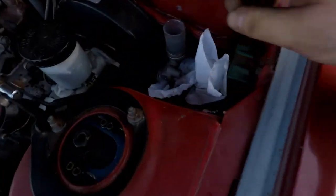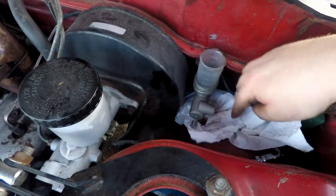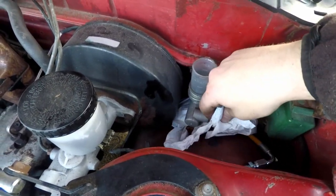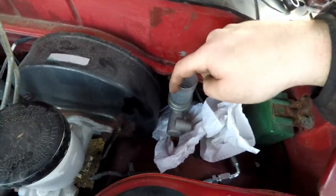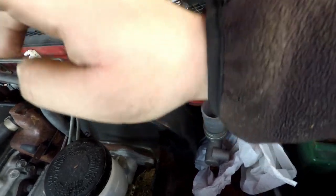I got the clutch line removed from the Master Clutch. Now the new line is going to be run down from the new one once I take this out, over the trans tunnel, and then down where this old line goes. I'm also going to delete the dampener - we don't need that, and I heard a lot of air gets stuck in the line. I'm hoping that's why my clutch last year wasn't as good, and I'm hoping this whole thing is going to fix my clutch and be able to put it into gear.